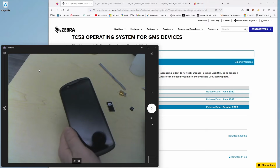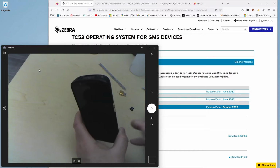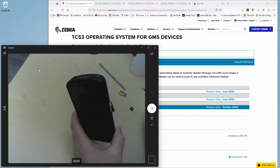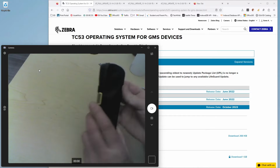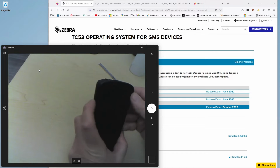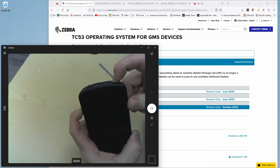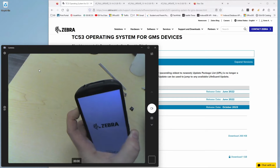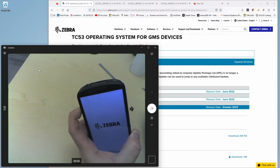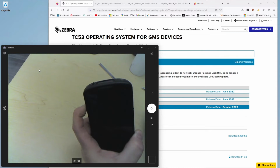Okay, real world, right? All right, so now when you're going to boot this device to an SD card as opposed to the operating system that's on there, you've got two buttons you got to hold. Power, and this one over here. So hold this one down and be prepared to hold that for a while, right? So pinch and hold, now hold the power. And when the splash screen comes up, you can let go only the power button. Keep the other one pressed. Keep it pressed until your hand starts to cramp up a little bit. And then sooner or later, you should see this screen.